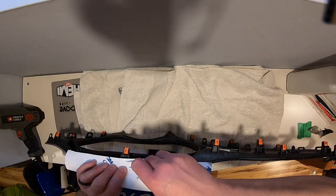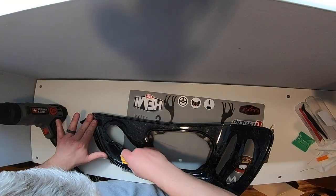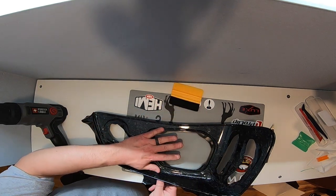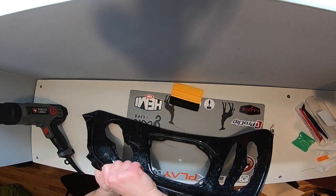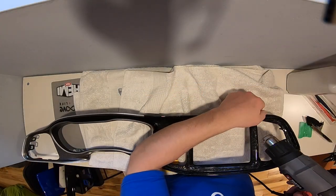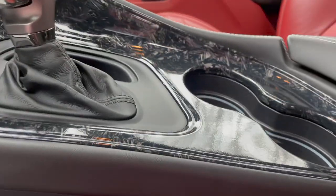On the dash bezel, I completed the work in three sections, and in the area above the speedo, I used the top as a template to cut the form before inserting it into place. Another tip is to press in and heat all the recesses before you wrap the vinyl over the edges. This will allow the air to work out and not allow bubbles to form inside all the grooves. The last and most important is to post heat the entire install to ensure no bubbles will form and that the vinyl is properly set.